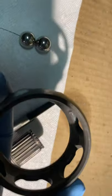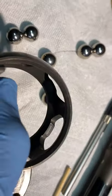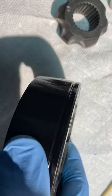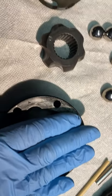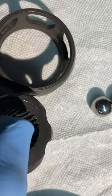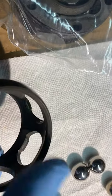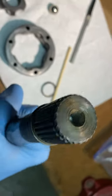You want that skinny bevel. The theory on the skinny bevel is so that when this thing is on the shaft, it can turn tighter or whatever. So the thin beveled edge goes towards the shaft. You will see the flat side when assembled. The beveled edge will be facing up because this side bolts towards the trans or closest to the wheel. You'll see the beveled edge in here — this side's flat, that side has no beveled edge on the very edge of those grooves, this side does. That's where the circle clip goes.